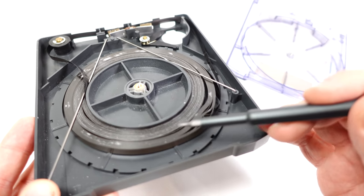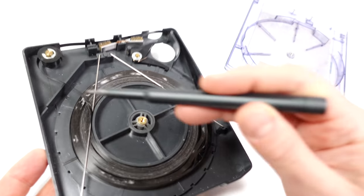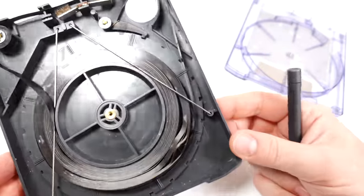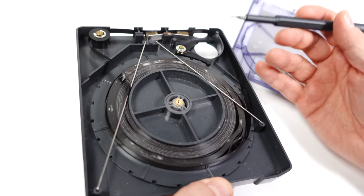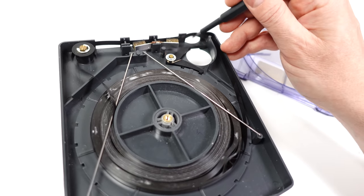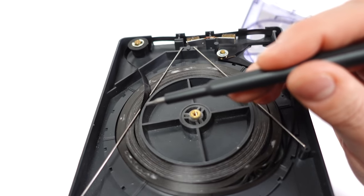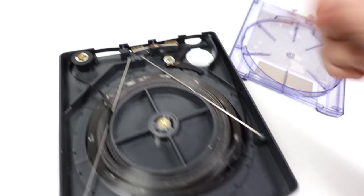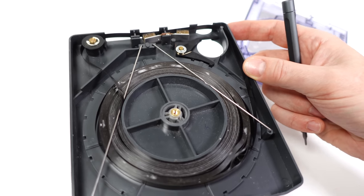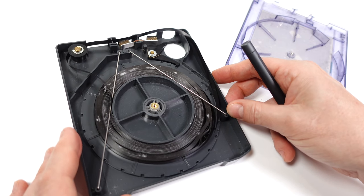You can see how the tape has got itself all bunched up in certain areas — that's the result rather than the cause. The cause is this mold on the rest of the tape, which is binding it together, meaning the tape can't spin freely. Generally these cartridges are really quite reliable, but this shows how finely balanced that reliability is. The pinch roller and capstan pull the tape through from the center of the reel, depositing it back on the outside, so any resistance at all will cause it to go wrong.